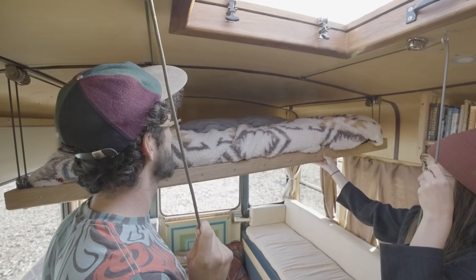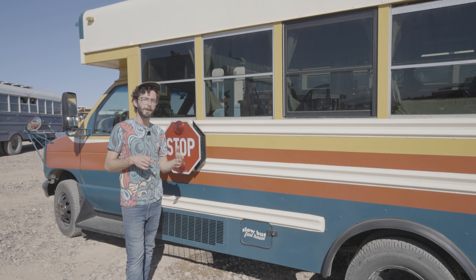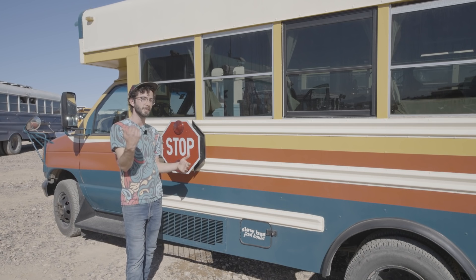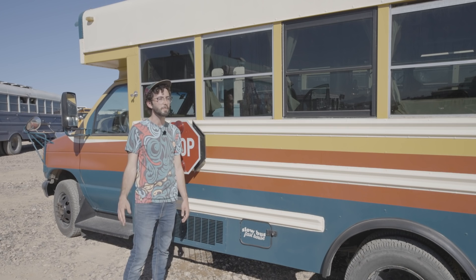So we painted the bus with Alkyd enamel. We picked out the paints at Home Depot using those little paint swatches and took them to a local paint company that mixed them up for us. We rolled it with four-inch short nap rollers. I'd highly recommend rolling your bus instead of spraying it — it's actually a lot easier than it sounds and it comes out really nice. Alkyd enamel is good for cars — it's been super durable. We only have a couple chips from significant knocks from rocks. We spent a couple days sanding down the bus and doing TSP and acetone, then did two coats of oil-based primer and then four coats of each paint, preferably in the morning or evening when the metal's not so hot.